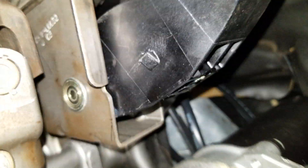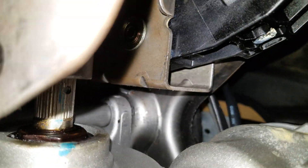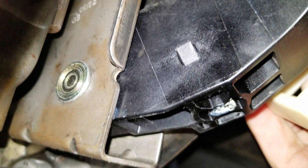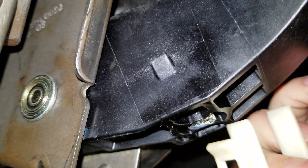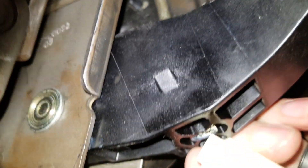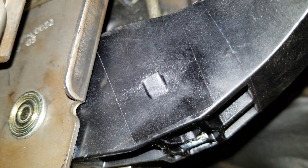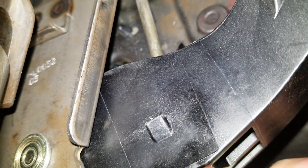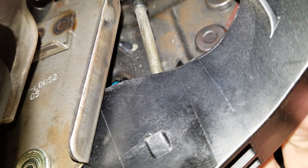And then from the front, while you have applied some pressure to it — you don't want to reinstall this without applying some pressure, because if you don't have the rod all the way in and then you go to install this and push on the clutch pedal, it'll slam into it, and that's probably not a good thing.